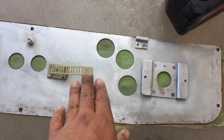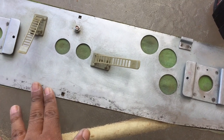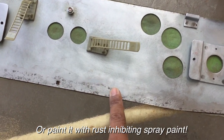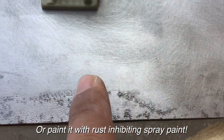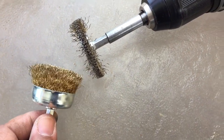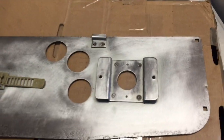Since this is now bare metal, we're going to have to coat it with some machine oil, or you can clean the dust off and put some sort of clear coat on it, otherwise it's just going to start oxidizing and rusting again. You can see the rust actually started to pit the metal. This is the best I can do — get some of these abrasive pads for your drill; it'll make the job a lot easier than sanding.